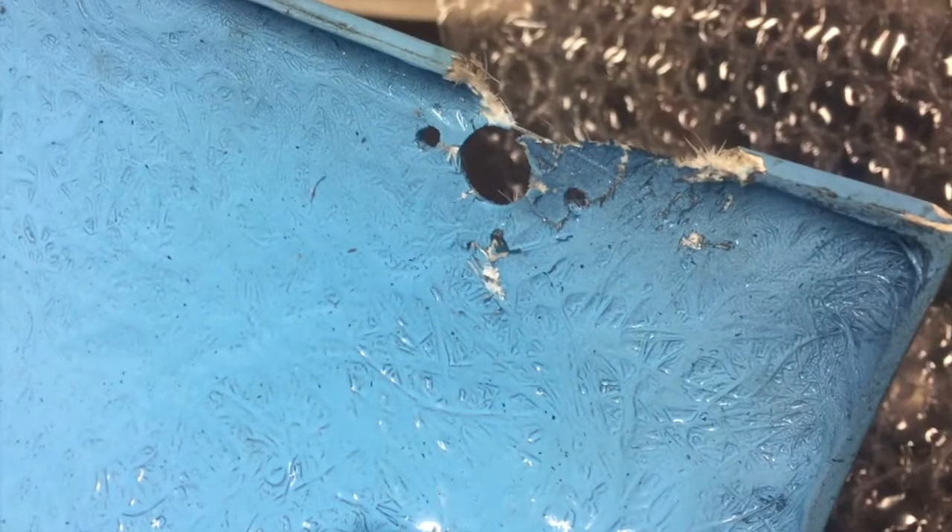One of the other little jobs I wanted to get on with was doing a fiberglass repair to the bonnet. This is one affected area, and that's the other. Basically what's happened is they've had bonnet pins in, and somebody's tried to throw the bonnet off without undoing the bonnet pins properly and just damaged it. So I'm going to patch that over, then filler it, and paint it into the correct colour, and start again with new fittings.